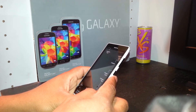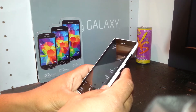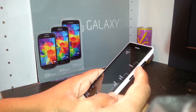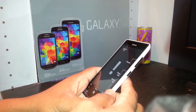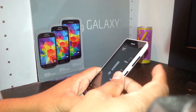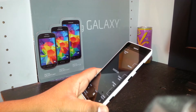When the Nokia logo shows up followed by gears working on the screen, the phone will start resetting. Now press and release the power key, then press and release volume down, press and release volume down again.